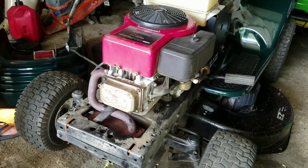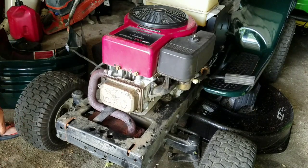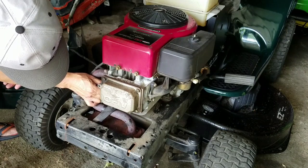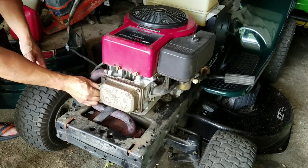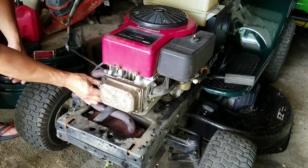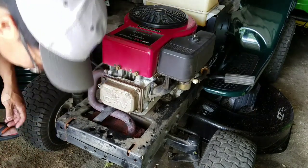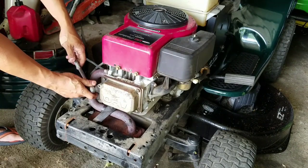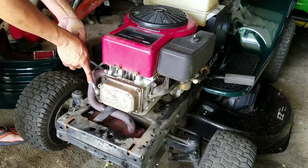Well, of course that was easy. The spark plug was out. Duh. Where is it? Oh. It still doesn't start well. It's probably the compression release is bad. It's not moving with the crank. Once you crank it once, it's supposed to move so that the cam lobe moves freely to help it to start. If it's in the way, it would be too much compression.